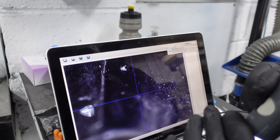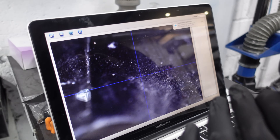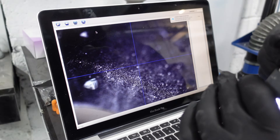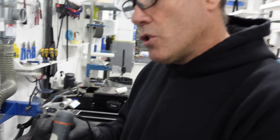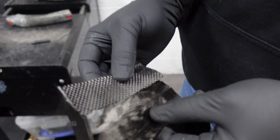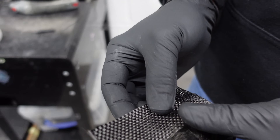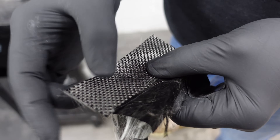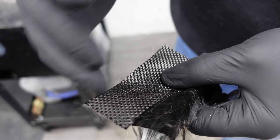Rob educated my naive brain on the types of carbon and how the weave pattern gives each frame unique properties. It's got no weave pattern — they layer it up in different ways. They could fine-tune the structure by laying one-directional carbon in two layers one way and then cross 45 degrees in another way, getting the most amazing properties out of a bike. This is uniweave — it weaves in certain directions, locking the construction of the bicycle in multiple orientations.